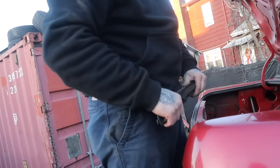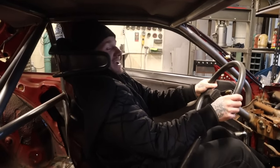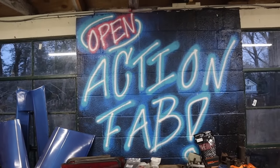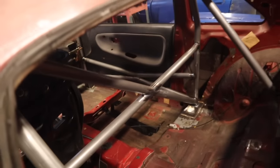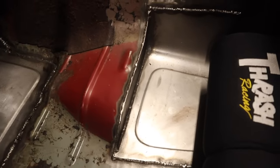What's up, it's Tom. We're taking the car to get caged - I guess that's like the first step of every drift car we build. Luckily enough everything was stripped out and ready to go, so we cleaned it out as you saw and now we're going up to my buddy Joe's house to drop off the car for him to start the roll cage and keep full interior. I'm Joe - Action Fab. We did a simple six-point, kept some room for interior, fully TIG welded, X door bars. We kept a dash bar so it's still got heater core and AC accessibility.